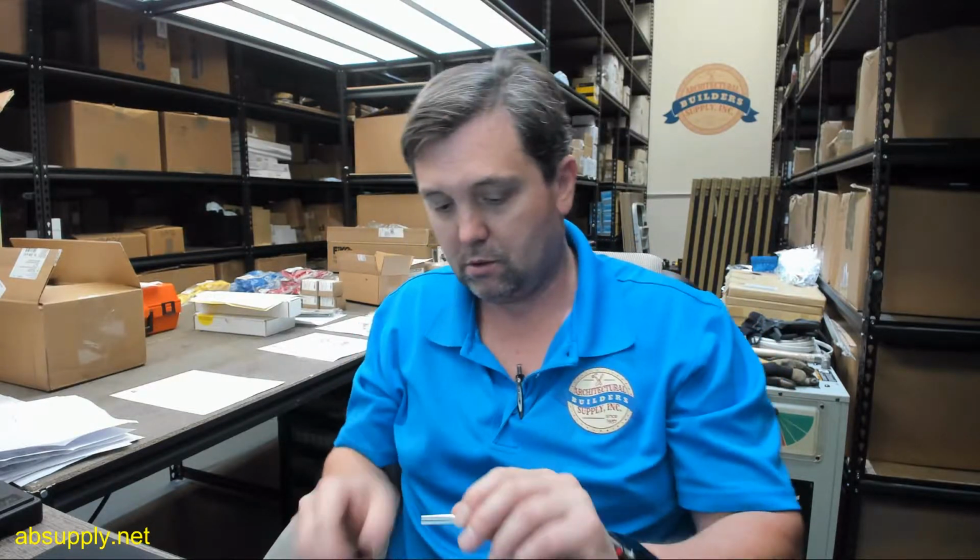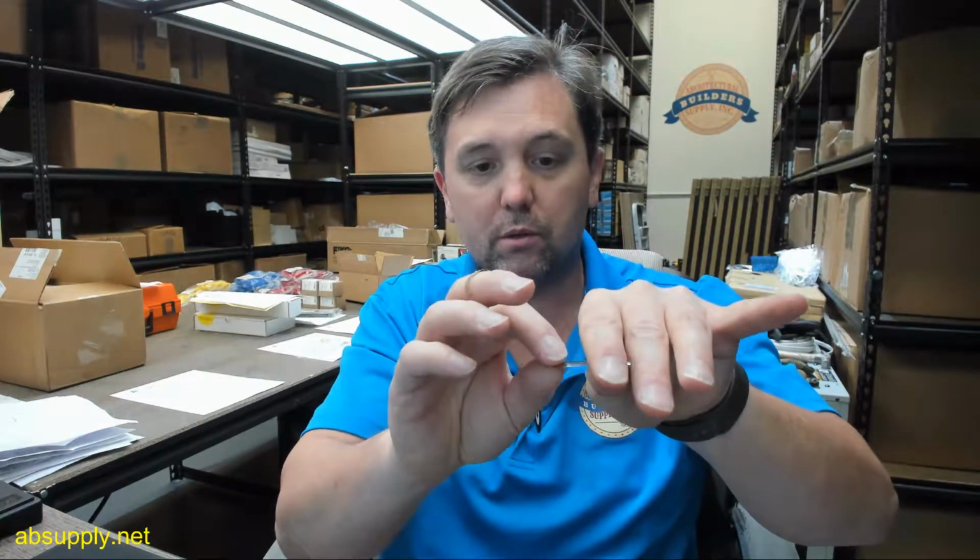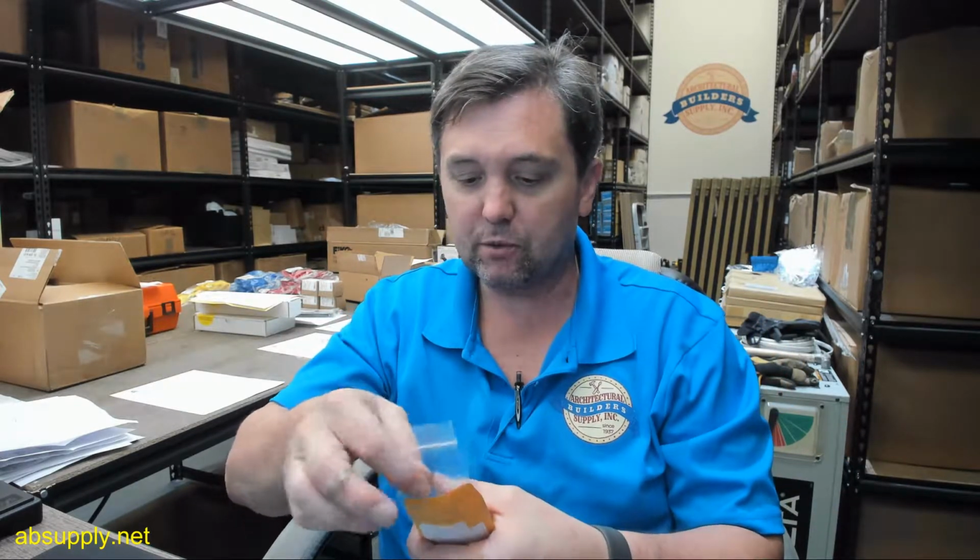When I'm holding it, I'll use my back finger to provide the stop by which I'm pushing with. I'll hold it kind of like that, and I'll be able to work it in this fashion with my middle finger being the stop. And as I'm shimming the cylinder, I'm applying some pressure on there. I'm halfway up the shim, which reduces the potential for bending it. And there are shim holders that certainly help reduce the potential for that, but I've never used one. I never found an absolute need to use one.